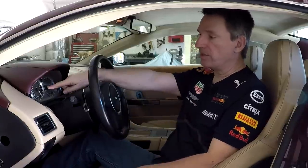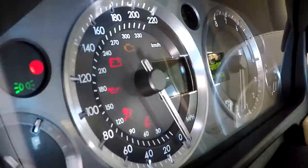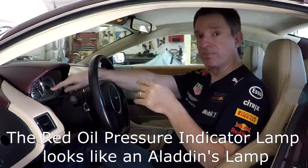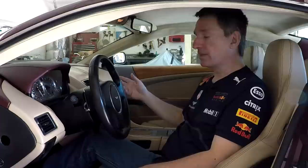What you're going to want to pay attention to is the oil pressure indicator lamp on the instrument cluster. When the light goes out, that means pressure is built up and there's oil now circulating in the system and you're good to go. So let's give this a try.